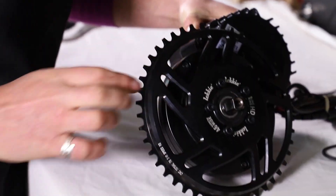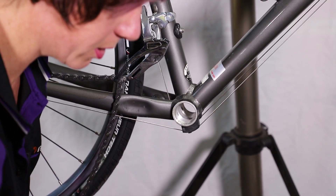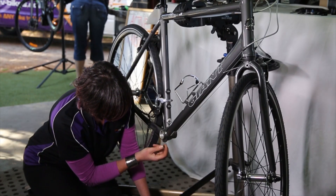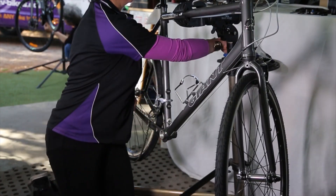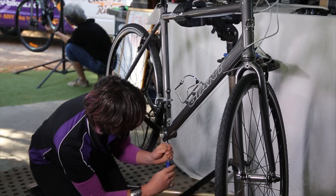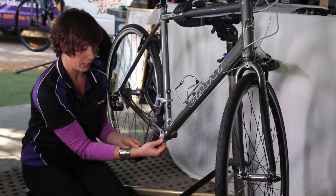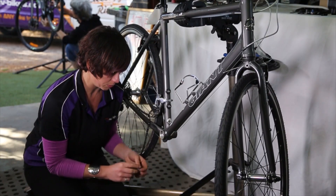So that's all in place and ready to go into the bike now. I've cleaned out this bottom bracket cavity. What we're aiming to do is put the bottom bracket of the motor through the cavity. The first hurdle we hit is this cable router underneath here — it's too deep. The channel that's carrying that cable needs to be removed. This will be the case on some bikes, not all bikes. The channel that is deep is the one we actually do need to retain for the rear derailleur cable, but the fact that it's so deep is something we need to change. I'll just take it off and we can have a look at what we will do.